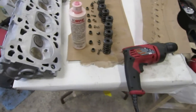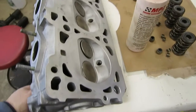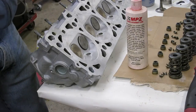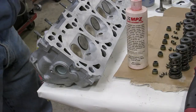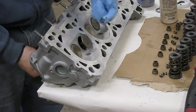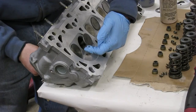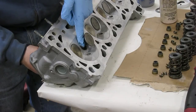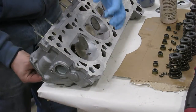I'm using my drill — I'm going to grab the back side of the valve stem so I'm going to be able to spin it and lap it. I don't know how good the lapping compound is for your skin, so I've been using a little glove. I dip my finger in, get some of the gritty goo, lift the valve up, and smear it onto the seating surface of the valve. Make sure it's distributed, with any excess on the valve seat side. Do the same for the intake valve.